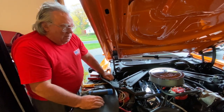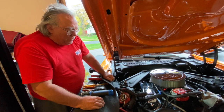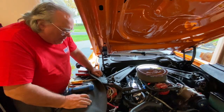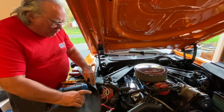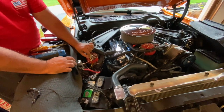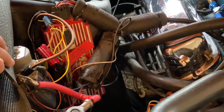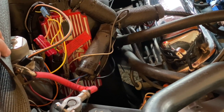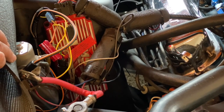When we get output from the alternator and full battery voltage is applied to the field circuit, we should get the most output we can get from the alternator in terms of voltage and amperage. So by jumping positive battery voltage to the field circuit, I am bypassing the regulator and telling the alternator to give me all it's got — and with the engine running, I was getting no output.